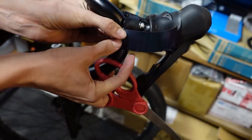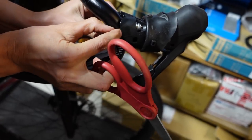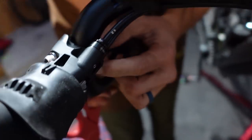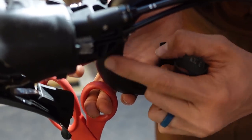The first thing we're going to do is take a little piece of bar tape — you can take it from the end or an extra bit and cut it. Basically measure it from where the handlebar starts to where the lever starts and where the hoods end.